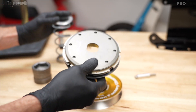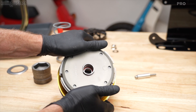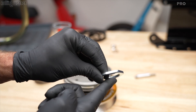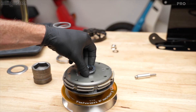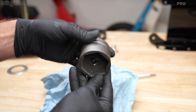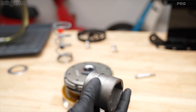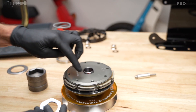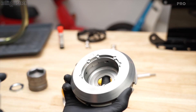When I push this down — I'll push it down and hold it with my feet; they've got special tools but this is the easiest way — notice how this nut flares up. You want it to flare up and then tighten it down. I highly recommend putting a rag over the nut. This is a clutch pulley socket, size 33 and 41 on both sides. When you crank it down with the impact, you don't want to mess up the finish of the clutch, so don't forget the little cover so you don't damage the aluminum.